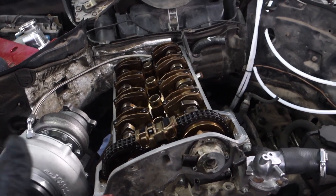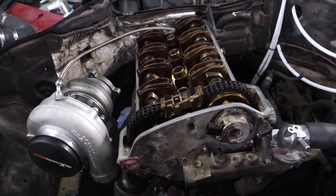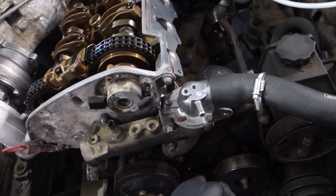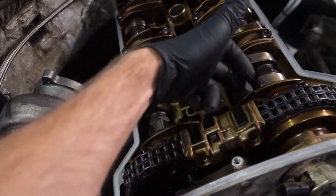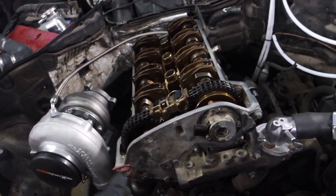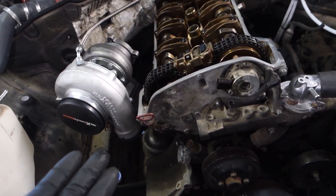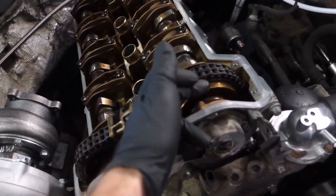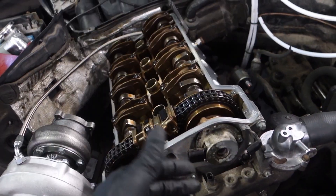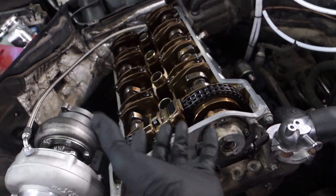You can set timing in two ways. One is the official Mercedes method, which is complicated because you need to set timing at 20 degrees crankshaft and insert locking pins. All other engines set timing on TDC because it's simple, but Mercedes decided to make it harder and also confusing — though there is nothing actually wrong with the VANOS system itself.